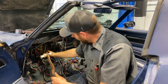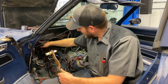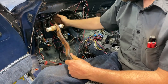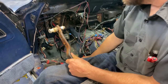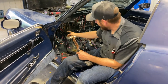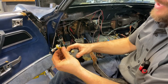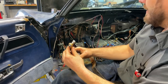Now that we kind of have it back in there, the clutch pedal won't come up all the way — it's hitting another bracket in there. So we'll have to take it back out and clearance that. I don't know if we can just bend it or whatever we've got to do. We'll pull that out. Also, you're not going to be able to get the pivot for the hydraulic master cylinder on there either.